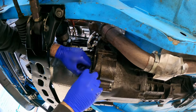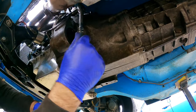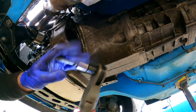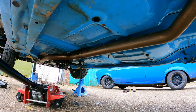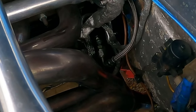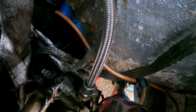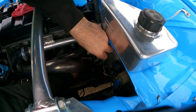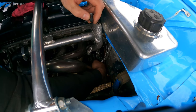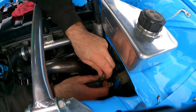With the wires removed from the starter motor I could then remove the one remaining bolt to remove it, and then I removed the broken piece. After admiring the damage it was time to start removing some bell housing bolts. This one up here is quite difficult to get to but a lot easier to remove with this electric ratchet. I used the jack to take the weight of the gearbox and then disconnected the hydraulic line from the slave cylinder. The line screws into an adapter which then screws into the slave cylinder, and I noticed that when I turned the spanner the adapter was spinning inside the cylinder as well - could this be the reason I was having issues with my clutch?